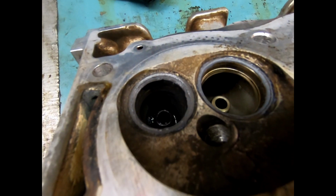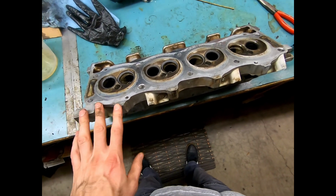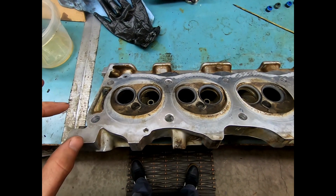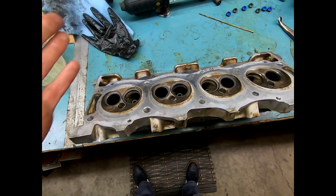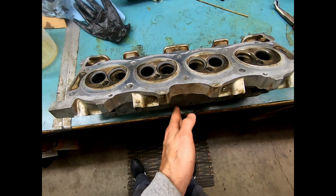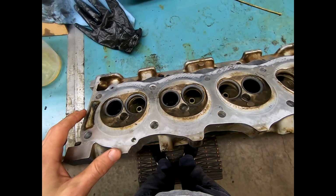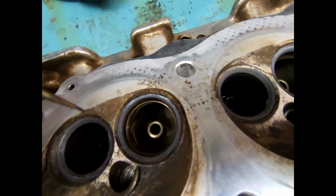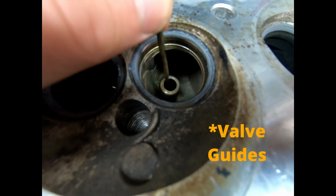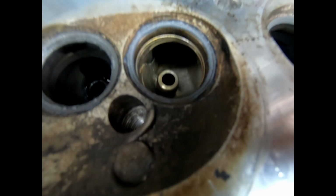Then after that's done, it also sprays that stuff down the cylinder. So the last step of cleaning. I got it all clean, or as clean as I care to, short of this last step, which is putting the entire cylinder head side by side, basically four rotations, the bottom half of this, the upper half of this, bottom half of this, upper half of this, in the ultrasonic cleaner to literally vibrate the sand away, because especially this material getting in here ruins your valves, because it just goes into this tight tolerance chamber and grinds sand in there for all eternity.